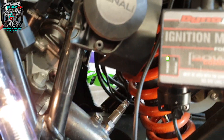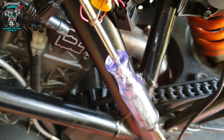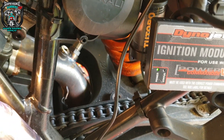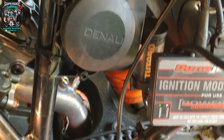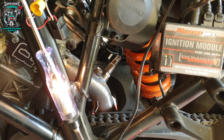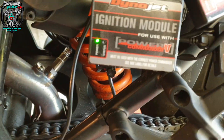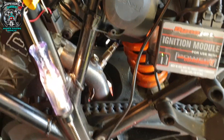Let's start it up and see what happens. I've got to turn the ignition off, let the power go away, let this module reboot. It's having a fit already. Yeah, it's running on one cylinder and it's kept its power. So I'm confident it's not the bike - it's definitely something to do with this module.